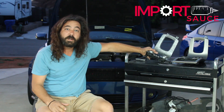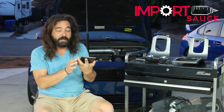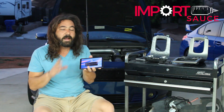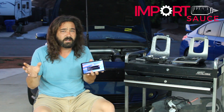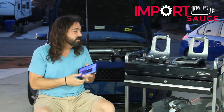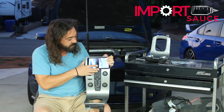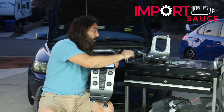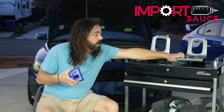After a ton of research — and it's very hard because nobody's making seven inch tablets anymore — we found the Lenovo 7 Tab, which still sells, has exactly the right proportions, and is a solid Android device. We trust Lenovo from years of office use. Since we hacked up our first waterfall, we went to the junkyard and got another one. Based on the size, we're going to be able to keep our top trim and side trims, sync this in with a border, and this thing boots fast — Pandora doesn't crash, everything's great.